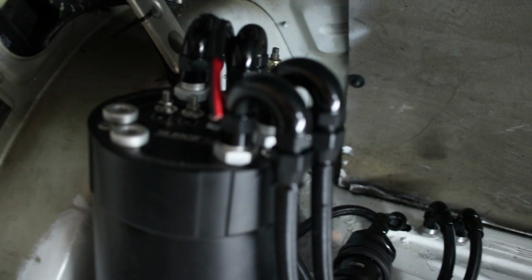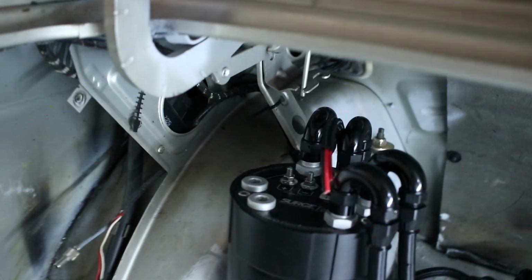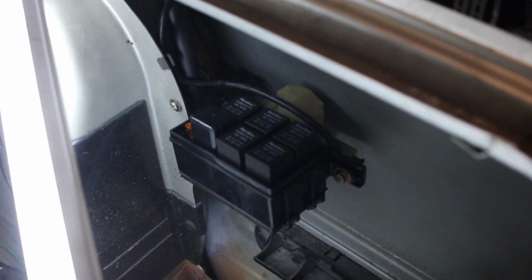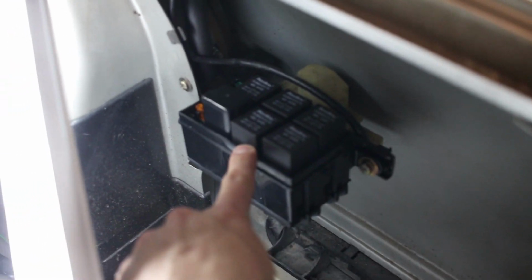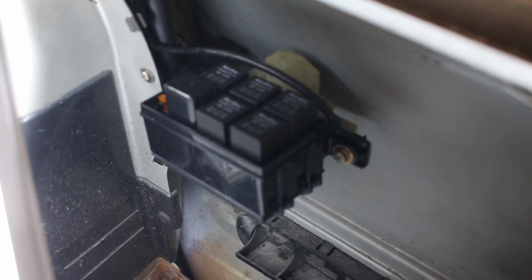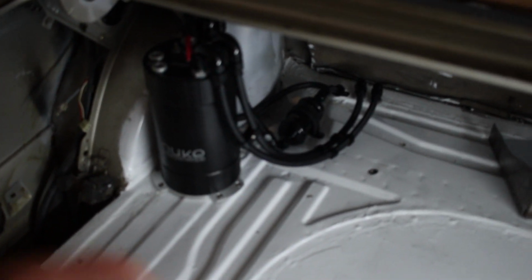It's all pretty clean. I just have to do the last wiring. This little wiring goes up and over into the little relay box that I got. It's mounted on there, and I'll run the power to this, run all my relays from this, because I'll need 3 relays, one, 2, 3, for the original fuel pump, or the original location fuel pump, and then the 2 in the tank. As far as all that's concerned, that is the Nuke and Vibrant portion of this.